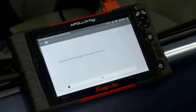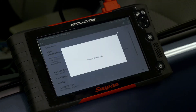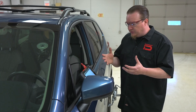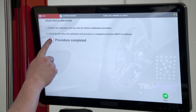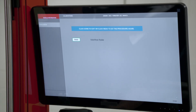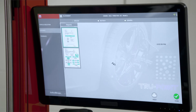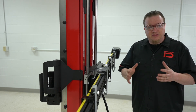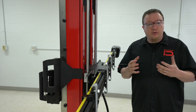We hit Continue and exit the test, then turn the ignition off to complete the procedure. The system also generates an ADAS calibration report. We can save this to the Snap-on cloud and also save it to the tool, allowing us to share it with customers or insurance companies as proof that we performed the recalibration. Back on the TruePoint system, we select Procedure Completed, then Next, then Done. On the report screen we have an ADAS alignment recalibration report and an alignment and ADAS audit report — a summarized and a detailed report. Both reports automatically upload to the Snap-on cloud service as long as the tool is registered and Wi-Fi is active.